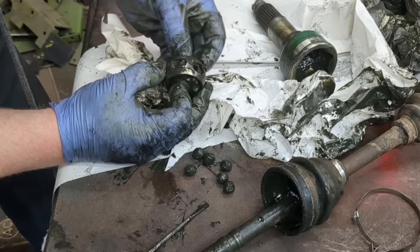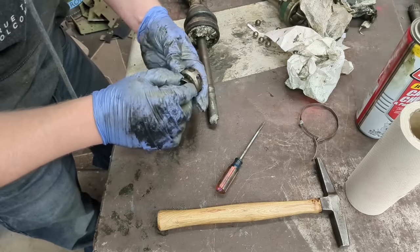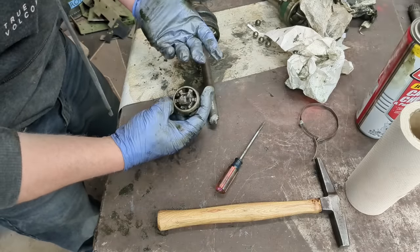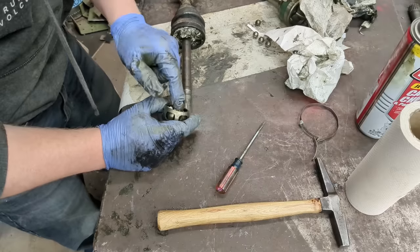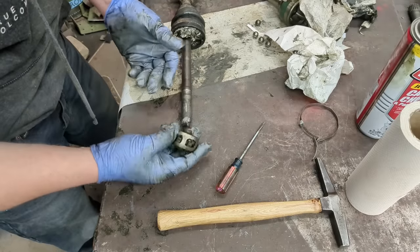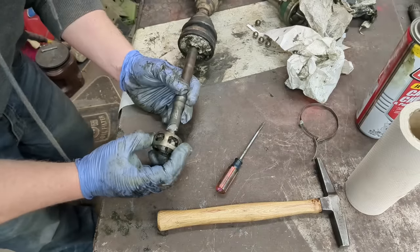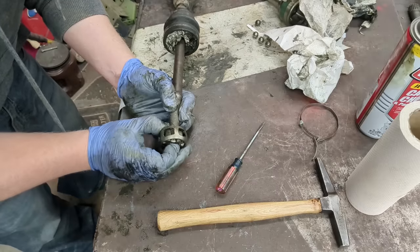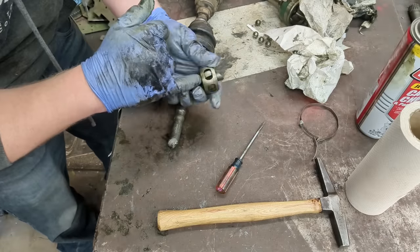What I'm going to do is put this on my vise over the edges and just try to whack this straight out. Okay, that doesn't want to come out — I think it's wedged itself. When it broke it wedged itself in there. Generally you would just hammer that out and swap in a new shaft, but I'm not going to do that. I could still get this out but I'm going to leave it, because I'm just going to weld it as is, since this part may be damaged as well. It's saveable, but if I can't find a shaft — and you know you can only find assemblies, not just parts — we're assembly swappers, not just part swappers. People would rebuild them if we could. So what I'm going to do is actually weld this to this, and it's going to get me by until a new one comes. I'm going to weld it to this as well.